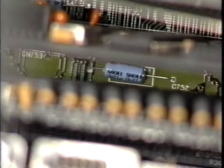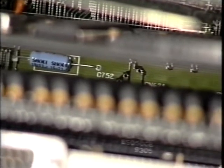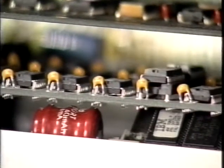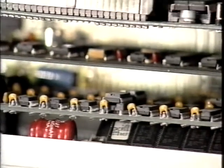To be able to choose between all of those colours, you have to extend your Amiga's graphics capabilities by buying a 24-bit graphics card — we've got one in this Amiga 4000. The only problem with Amiga 24-bit graphics currently is that 24-bit cards remain expensive, though the results they give are pretty stunning. We're still awaiting the emergence of a truly retargetable graphics standard, so that 24-bit graphics software doesn't have to have specific drivers to work with particular cards. Until that happens, it remains, in my opinion, an area of Amiga use that's best left to the specialists.